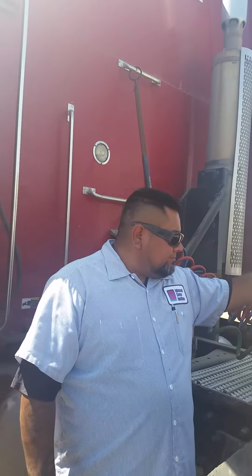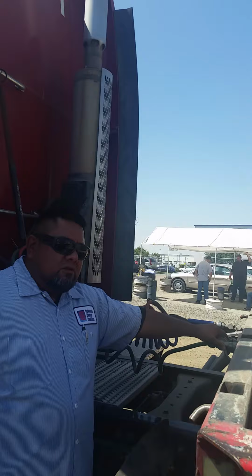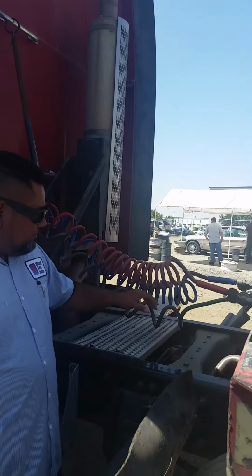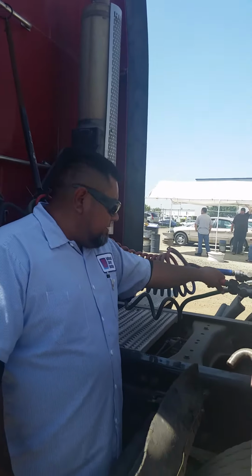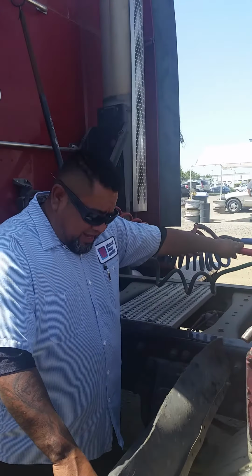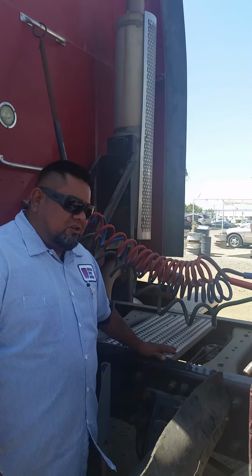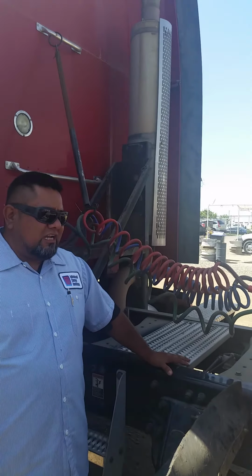I'll be inspecting my glad hand, securely mounted, no leaks with good rubber seal. I'll be inspecting my drive shaft, securely mounted, no cracks, no dents, no leaks, free of debris, and properly lubricated. I'll be inspecting my catwalk and steps, securely mounted, no cracks, no dents, no holes, nuts, bolts are present